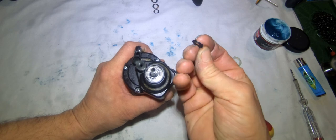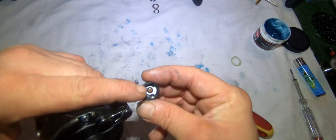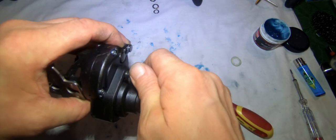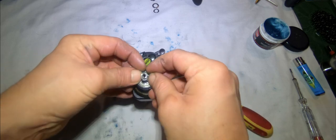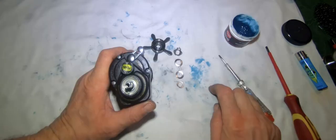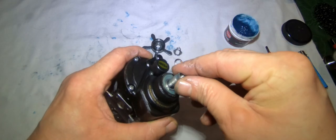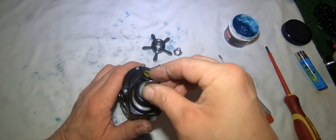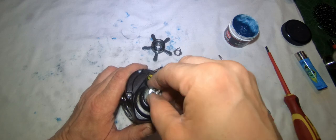The black plastic piece has two tiny little lugs on the back that go into two tiny holes. Take extra care putting this on, making sure that the center part does not come out - put it on square and it gives a couple of clicks. That's the washer for the anti-reverse bearing. Now we're going to refit the star drag. The compression washers bend upwards - place one onto there and slide it down, then the other compression washer also faces upwards, and the top one is concave and faces downwards. These pressure washers compress together to form a sort of spring.